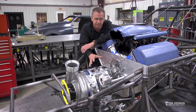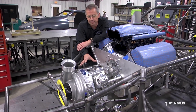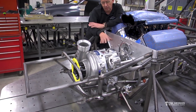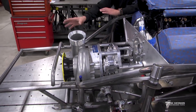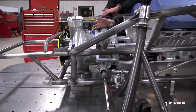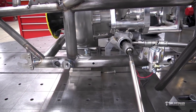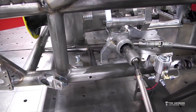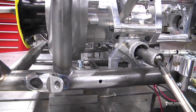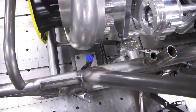Just like anything else, this stuff is evolving faster than they can make parts for it, so there are changes coming all the time. But if you're going to switch over to something like this, you have to consider a lot of things. Number one — do you have room to hang all this garbage off the front of the engine? It takes up a lot of space. We still have to put fuel and oil tanks up here. One of the big things is the rack position. You can see where this rack is mounted — it has to be moved back. The rack can't be in the normal location; racks are normally up about five or six inches farther forward than they are right now, just to give us room to get everything in and out of the car.